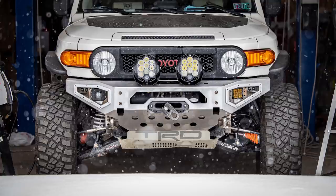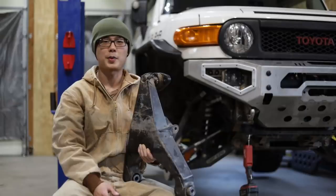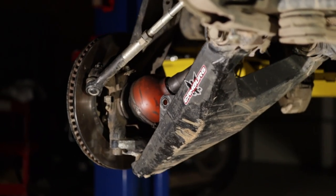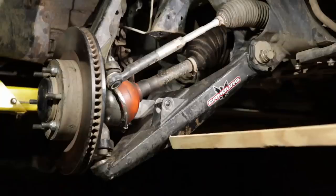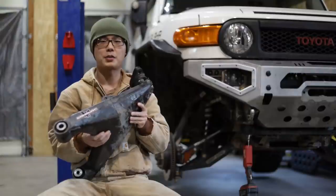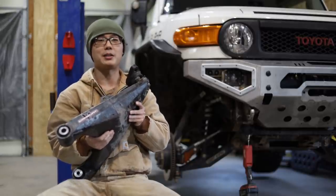Here are some pictures showing the ground clearance difference at ride height. From my measurements, Dirt King's lower arm sits 0.8 inch higher at the coilover and 2.8 inches higher near the tire. For high speed off-road, ground clearance in this area is probably not as significant as it's very close to and moves up and down with the wheel. But I can testify for rock crawling, you want every bit of ground clearance anywhere under your truck — I get hung up here often. The one thing both designs did right is this slanted front surface. It helps sliding over rocks easier, which is pretty much inevitable. Some manufacturers have straight corners on this leading edge — those probably simplify fabrication, but are not ideal for rock crawling.